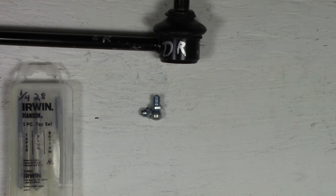So basically I'm just gonna lower it down like so, and then spin the pulleys by hand until it gets threaded to the bottom. So let's do that. Again, I'm using the bottom tap. I'm gonna turn it on to make sure I have it nice and straight in the chuck, and then I'm gonna turn it off and do it by hand.